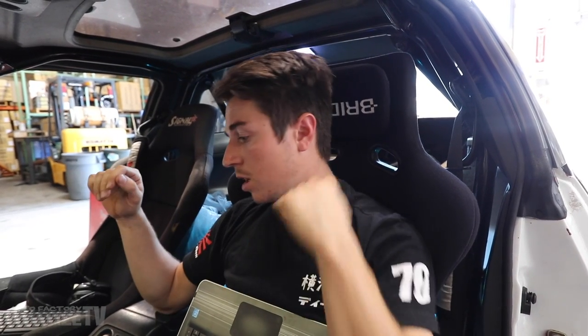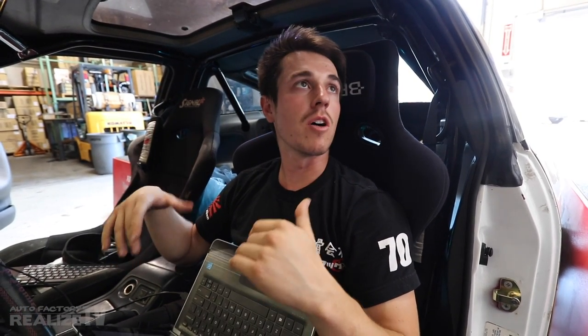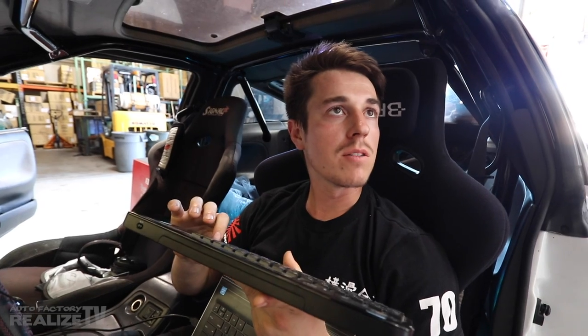So I don't know if it's just the design or how old it is, but it's just too laggy. I think you'd probably be better off adjusting the rod on the wastegate and then setting boost pressure off that. If you had an Apexi one, we could get it to target a certain amount. I don't know. Good job.